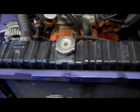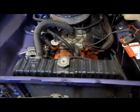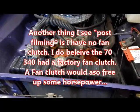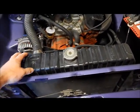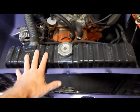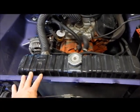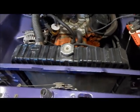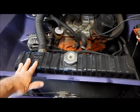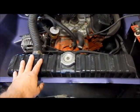I've ran the car like that, but I want to get a nice decent hose on it. If not the correct radiator, just for better circulation — there should probably be a fan shroud. I don't have one of those. Back in the day, the six-cylinder radiator — I should have kept the eight. I don't know what I was thinking. Back then these cars were in the junkyards and it was assumed that parts would be around forever. We know now that stuff's drying up. But this radiator was rebuilt, re-cored, triple core. So this is actually a good radiator, it's just the water outlet's on the wrong side. I took this to a radiator shop back in the day when people were still rebuilding brass radiators. Now they're all plastic and aluminum. I don't even know if radiator shops do anything more than re-crimp the tanks and change the seals. But there was a time they would unsolder these tanks, put a new core in, and solder it all back together, pressure test it. So almost 25 years ago this cost me between $200 and $300 to have this rebuilt. It is a good, extended-capacity six-cylinder radiator — it would work for this application.